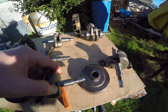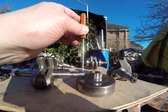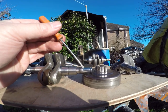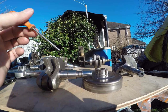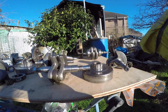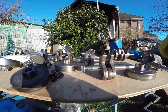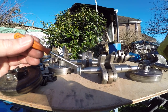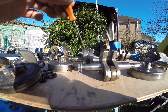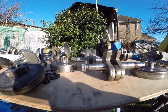This is a reminder of what that E-clip groove should look like — nice and crisply defined. On this one, the crank has been cleaned up with 1000-grit wet-and-dry, spun in a lathe to do that evenly. On this end you can just see that nut is at a funny angle — so there's a bend in the crank just here. This was dismantled in a bit of a hurry and someone has actually bent the end of the crank, so this one has other issues as well.